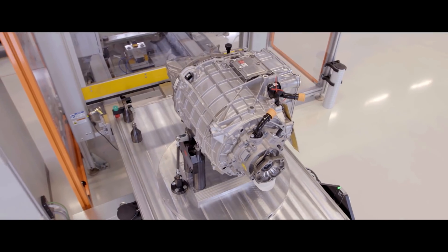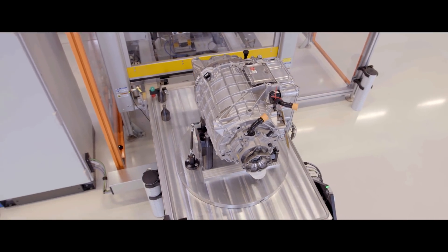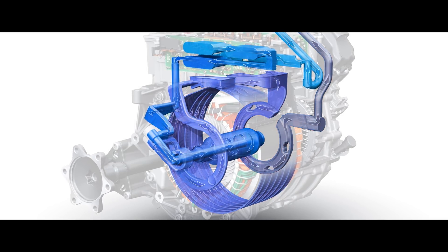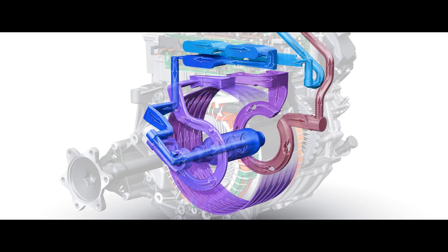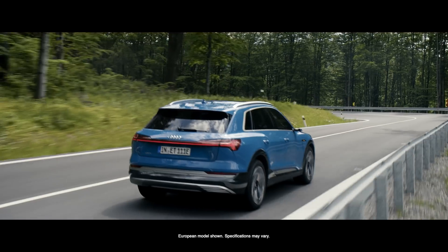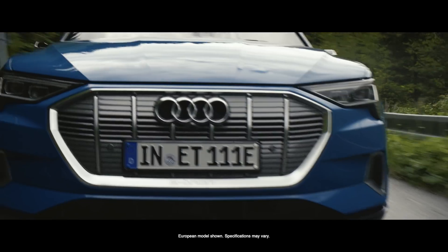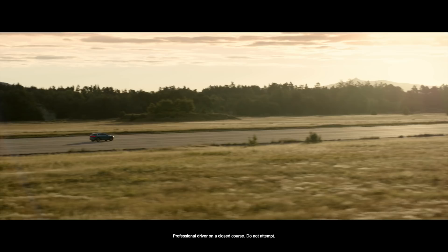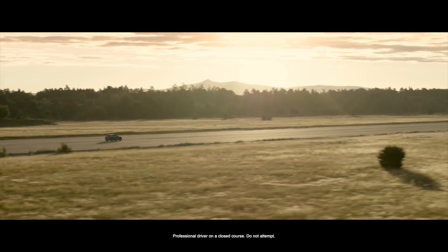From the beginning of the project we took a lot of effort to make really good cooling of the machines. We have cooling water of course around the stator, also rotor internal cooling and bearing plate cooling, so in fact the electric machine is completely packed with water — and this is special for Audi. Normal electric cars can manage to accelerate from 0 to 100 maybe 4 to 6 times, and we can manage this maybe 10, 15, 20 times with no problem, without making the machines too hot.